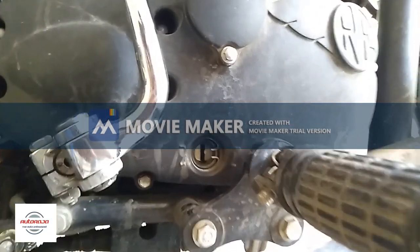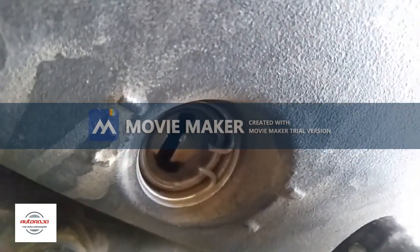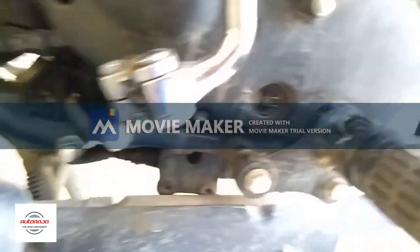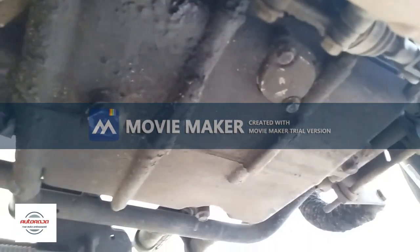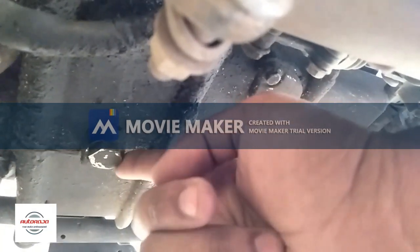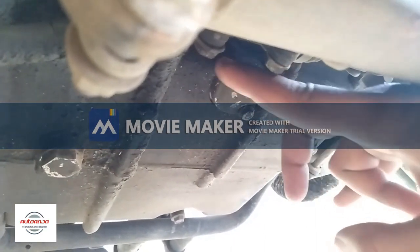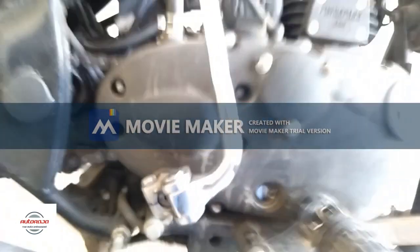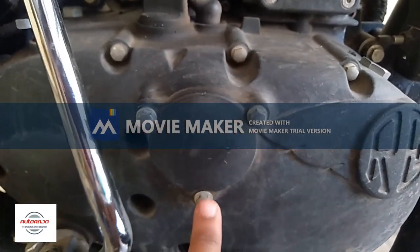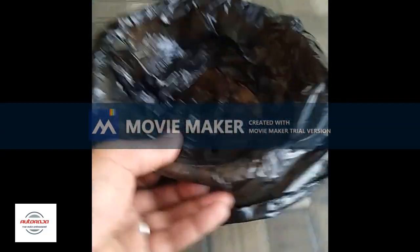Beginning with, we'll have to initially see what is the level of oil present in the engine, and as you can see, it is below the minimum level. And going to the under chassis, under the engine, you have this drain nut which has to be removed while draining the oil, and there you get another two screws that have to be removed. That is basically the mesh oil filter that is placed beneath the engine bay. This is the oil filter which has to be replaced. So you remove that cover and you get an oil filter which has to be removed. And this is what you see, a plastic cover and the basin just to collect the drained oil.